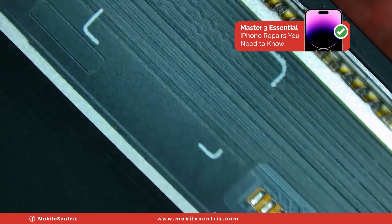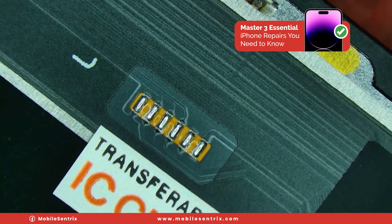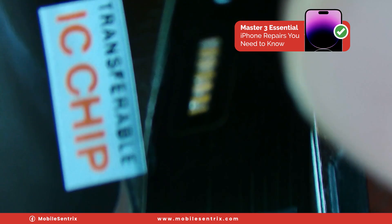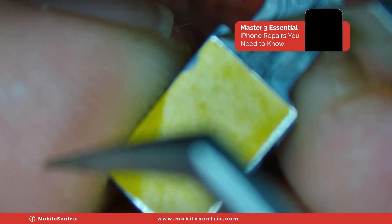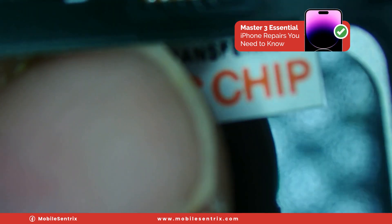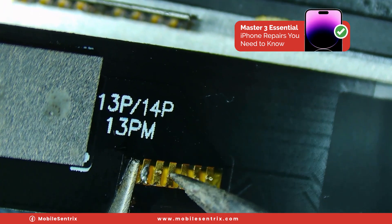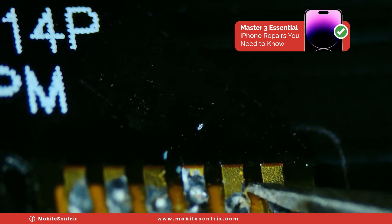The next step is to solder right here where it says transferable IC. You can see the little grid and the six solder joints. We'll peel up the flex so it's not touching the display, then on the back peel off the protector for the adhesive. We'll line it up, compress it into place, but pop it back up for a second so we can solder these joints. We'll take a little bit of flux, pinch on the cable, and solder — you can see the solder pop through. We'll do the same on the other ones, making sure each one of those joints has plenty of solder going through it.